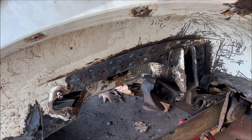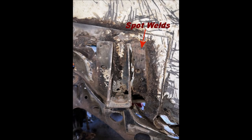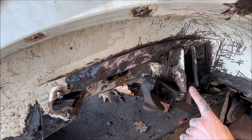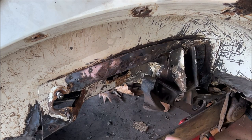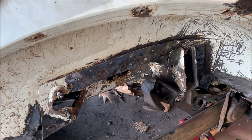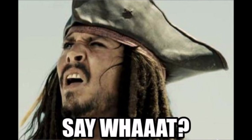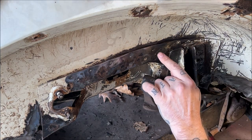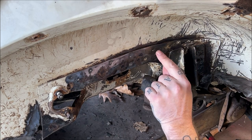The third week we're going to start on the body work — there's rust behind here. I'm going to drill the spot welds, hit everything with heavy PB Blast first, pull the body mount out of the way, and then grind it down. I have a spot weld cutter I picked up at Riley's — and it's weird, they put a lifetime warranty on it. If it ever dulls or breaks, bring it back and they give you another one. It'd be like returning a drill bit over and over.